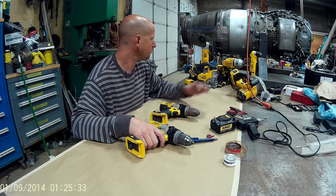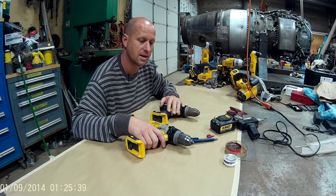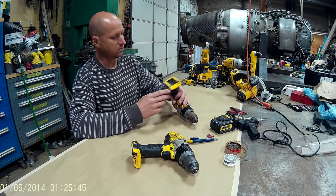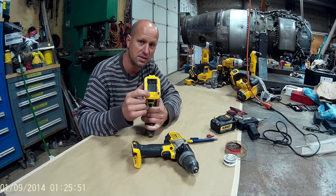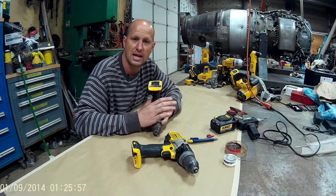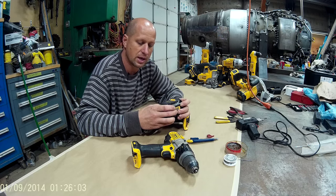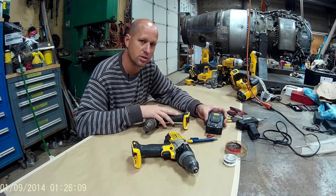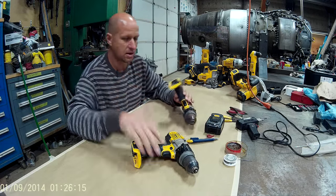I had this affect tools like impacts, rotary hammers, things like that, that have a lot of impact and vibration. If you look at how the terminals are made, you've got four terminals here. The larger two are the positive and negative from the battery. The other two I'm not sure of the exact function, but I'm going to guess there's maybe a temperature sensor buried inside the cells, or maybe it's measuring cell-to-cell voltage instead of the whole pack voltage. It lets the drill know something about the state of charge in the battery, possibly battery overheating.